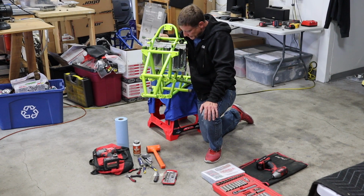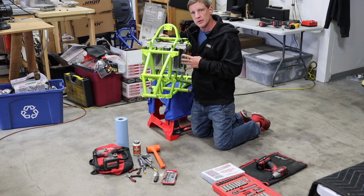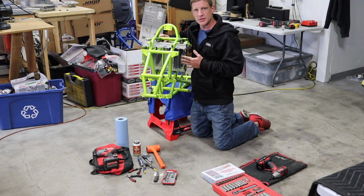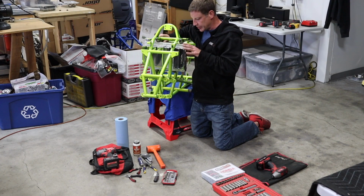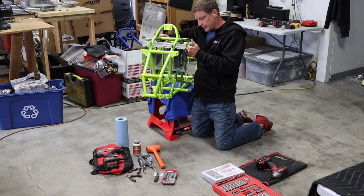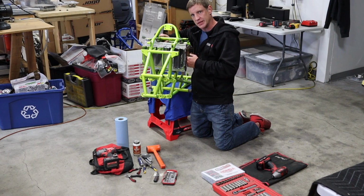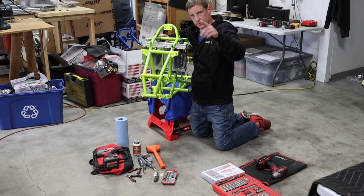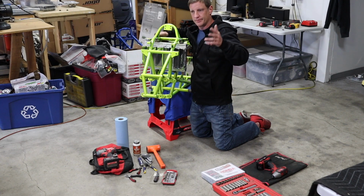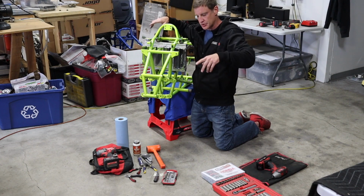So as far as using louvers, they're not required. And a lot of people say, are they just for looks? Well, they're not. With his setup, when you put the shrouds on, they're tied up against the radiator sides. In fact, he even uses a piece of weather stripping in there to keep it sealed. And if you think about how air moves, it's going to move in a circular motion. Think about all air, you've got tornadoes and all this other stuff. When it collides, it creates a circular motion.